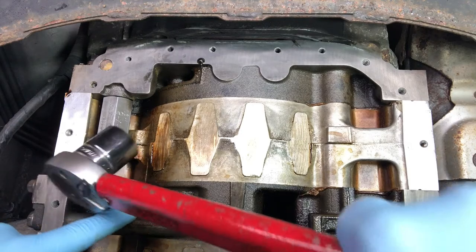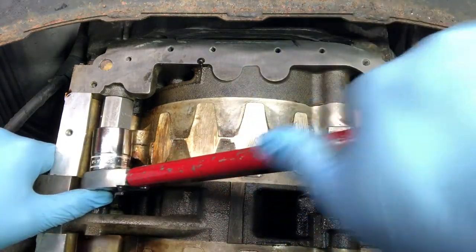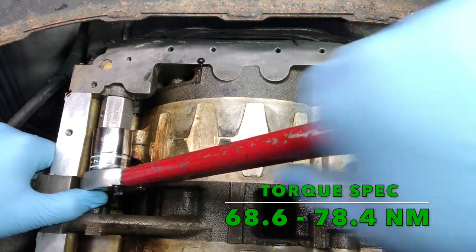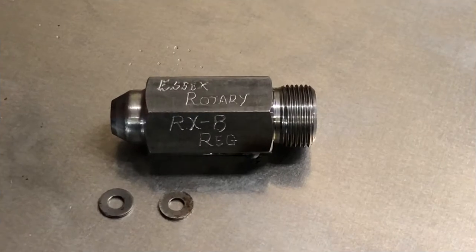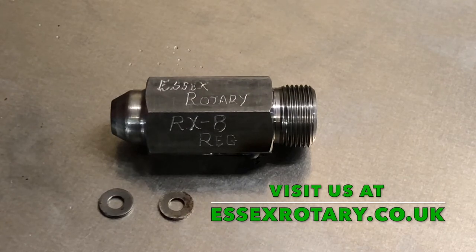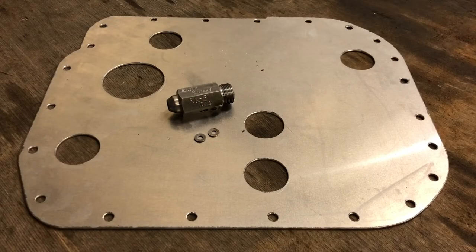With the rear oil regulator now screwed into place, we're going to torque it up using a half inch torque wrench and 26mm socket, torquing it to around 70 Nm. The actual range for this is 68.6 to 78.4 Nm. With the rear oil regulator now torqued into place, all that remains is to reinstall the rest of your oil pan components, fill up with oil, and enjoy your increasing oil pressure. To order your Essex Rotary Enhanced Oil Pressure Regulator for your Series 1 RX-8, head over to our website at essexrotary.co.uk. You'll find the link in the description below the video, where you'll also find our oil baffle plates, Greddy oil pans, and many other parts for your RX-8 and RX-7.